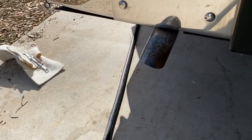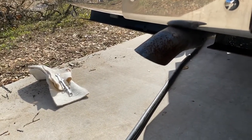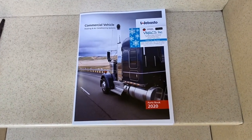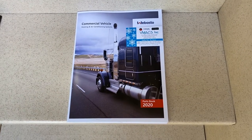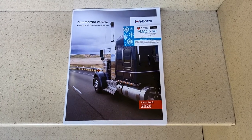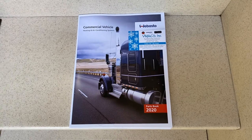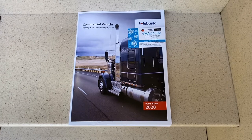The system's on and you can see there's no discolored smoke coming out — it's burning nice and clear, which is a good sign. I burned out a couple of these over-temp fuses; they'll blow at 280 degrees Fahrenheit. Rudy Leggett out of Houston has helped me a lot — I've bought parts from him. This company advertises on eBay, and I've ordered a couple of fuses and the true Webasto filters from them.